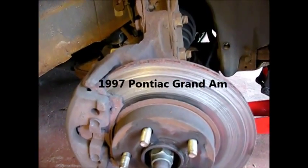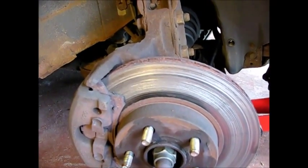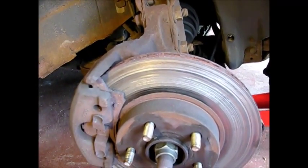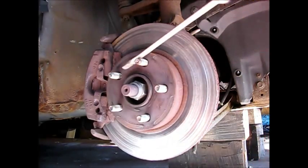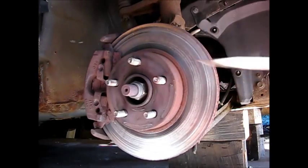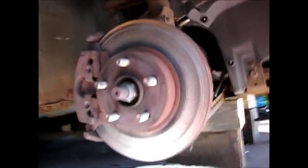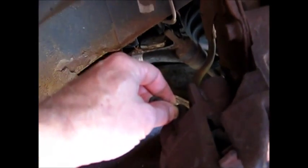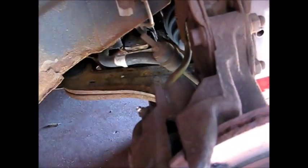We had a tremendous grinding sound coming from the right front of this Grand Am, and even when the brakes were not applied, this grinding was occurring. You can see how hard this is turning — it's pretty much locked on. I've cleaned this up with some brake parts cleaner. There's a possibility here of a brake hose causing a problem like this, and one way to check that is to back off the bleeder to relieve some pressure in the system and see if the caliper then comes back and loosens up. We're going to try that first.